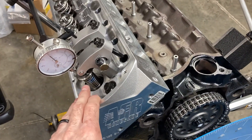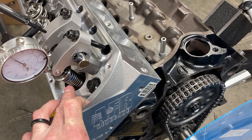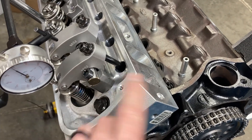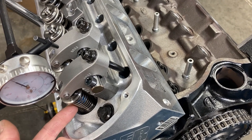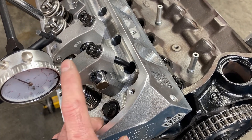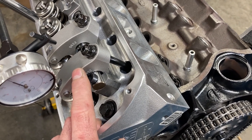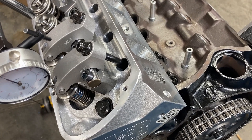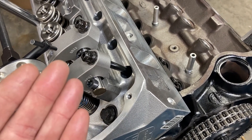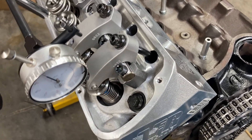With a checking spring you get less clearance than with an actual spring, for a couple of reasons. One is that you don't get any deflection in your valve train parts because the spring is only maybe a two-pound spring. The other reason is that most aluminum-bodied rocker arms have some ratio designed into them because you do get deflection with spring pressure — they change the ratio to counter that deflection. So with no loading, sometimes you get a higher ratio than what you're expecting.